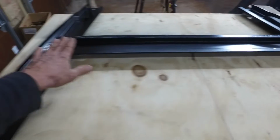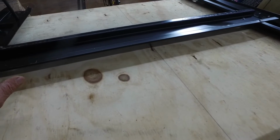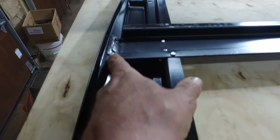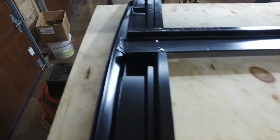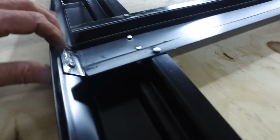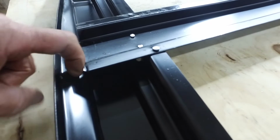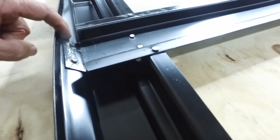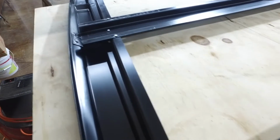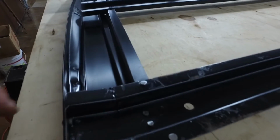So then I took my cross rails and I began to cut them. So what I did is I cut it off, but I left this little flap. So I have a flap that I folded and I was able to shape it to match this angle. And I did that on both sides. I got my measurement, I cut it up, I got it to fit nice. Cool.